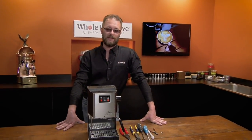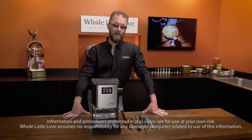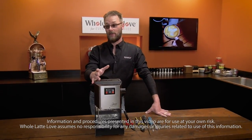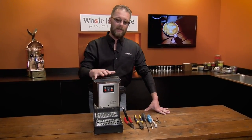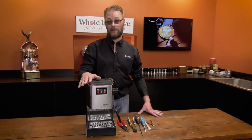Hello, my name is Ted. I'm a repair technician for Whole Latte Love Repair Center. This video is to show you how to change the thermal fuse on the boiler in case you have lost power to the machine. What has happened is the thermal fuse has failed, or a surge of power made it blow. For whatever reason it may be, it's cutting power off to the machine, and this is what we're going to do to change it.